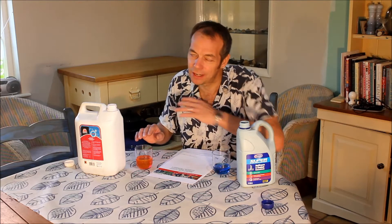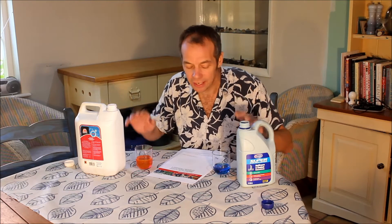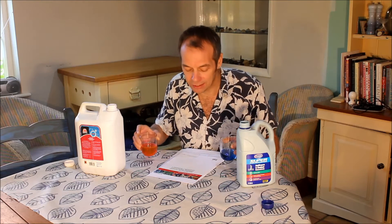They're both ethylene glycol based - and all we're going to talk about today is ethylene glycol based anti-freeze, which forms the vast majority of anti-freezes on the market. There are other anti-freezes available, like Evans waterless coolant, which uses a completely different chemical. They're not very common and quite expensive, so we won't cover those today. If you go into a local motor factor and ask for anti-freeze, you'll overwhelmingly be offered one of these two types: the blue or the red, both based on ethylene glycol.